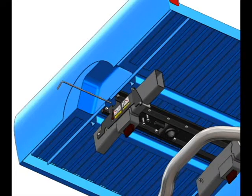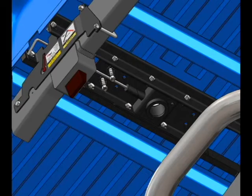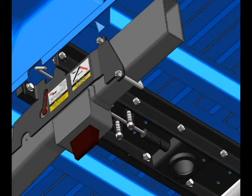From the driver's side of the truck, slide the rod into the opening where you notched the bed seal. You will need to align the handle so that the set screw seats into the dimple in the rod, and tighten to 15 foot-pounds of torque. It's not a bad idea to put a dab of Loctite on the set screw. To unlock, simply turn the rod 90 degrees counter-clockwise, and to lock back into place, turn the handle back to its original position.